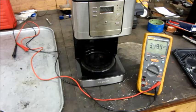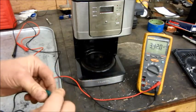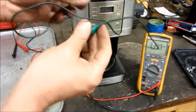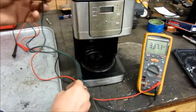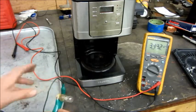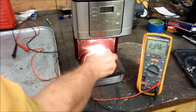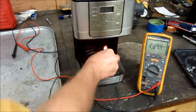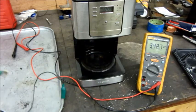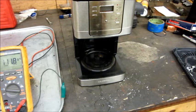I've got a 120-volt 15-watt light bulb clipped into a test lead. I connect one part of the lead to the grounded tabletop to simulate the kitchen sink or stovetop, then carefully touch the other lead to the warmer plate. Look at that — I'm picking up enough power to light up that light bulb at full brightness, and the coffee pot's not even on.